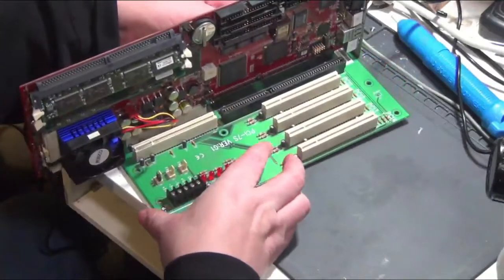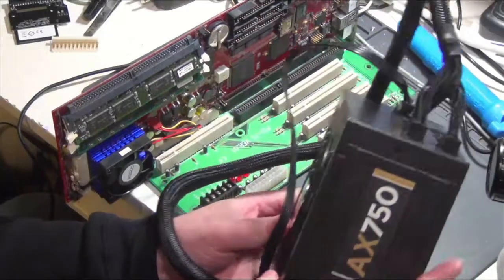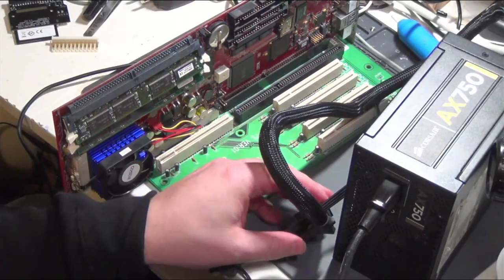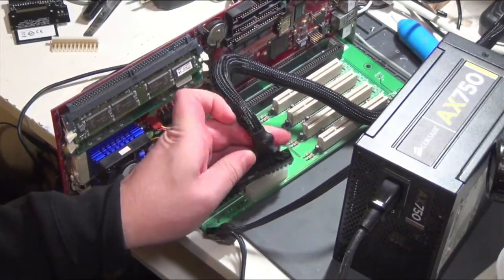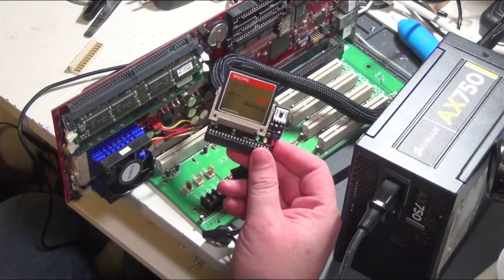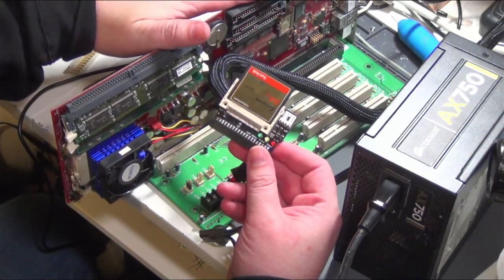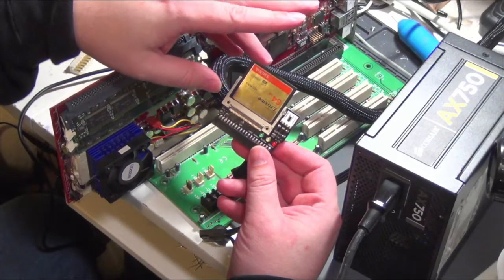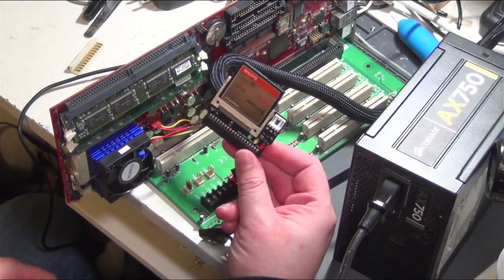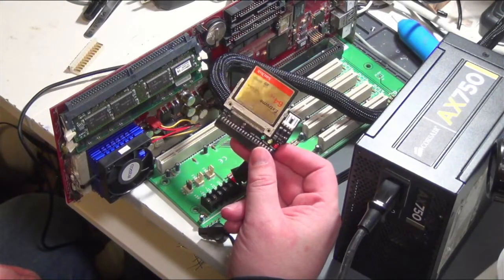So what I've got to do is get a power supply out — I have one sitting right here, a power supply I pulled out of my gaming PC because I upgraded it to 850 watts. For the hard drive I'm going to use an IDE Compact Flash adapter. Because I don't want to involve CD-ROM drives or floppy drives, I'm going to install Windows 98 onto a virtual machine or maybe an emulator of some kind — this is all kind of untested. Then use a tool like DD to copy that image to the CF card and boot it up. See if that works.